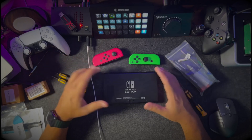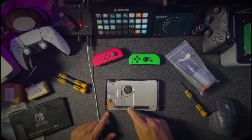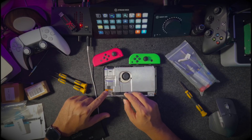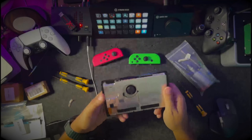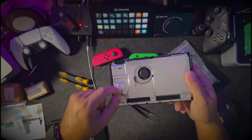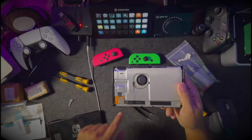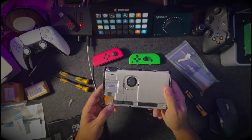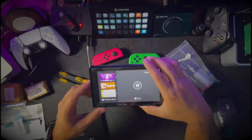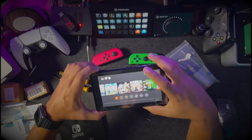Now that we have the screws out — and as you see, it wasn't that many — the case gets popped off. Right there is the problem. Let's first see if we can fix it just by checking if the connector got disconnected. I heard it snap in place. You lift that up and it lifts off the motherboard — it's a little socket. Place it back and snap it in, make sure you hear it snap. We're going to put the SD card back in, turn it back on, and see if it continues to not be able to read the card. It's still unable to access the disk, so we're going to go ahead and replace it now.